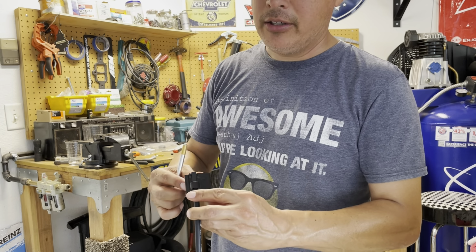What you do is you just press down your X-Acto knife or blade, whatever you're using, and you twist the cable. Just twist it a couple times. I kind of do it back and forth. So then, once you have the cable cut, you just grab the end there and turn it counterclockwise. That's what the directions say. I'm just kind of explaining this to you. And it'll twist right off. So there you have your conductor.